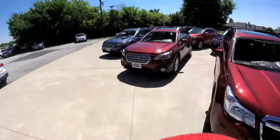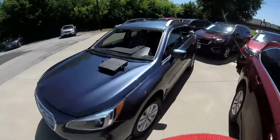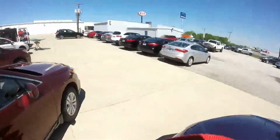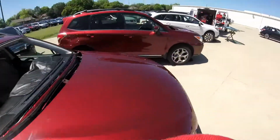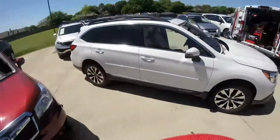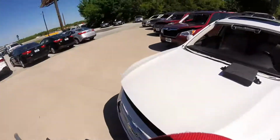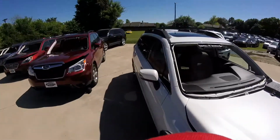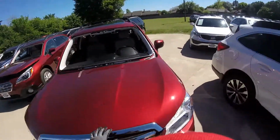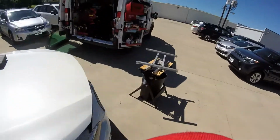Okay guys, as you see, I already pulled four windshields. We stripped all the parts. We're gonna just clean them up, all the glue, the urethane, and I'm just gonna primer the glasses and everything. I'll just come back when everything is ready. Okay guys, so we already primered this one and the other four. Already primered, we just covered the scratches. It's clean, all is ready to set.